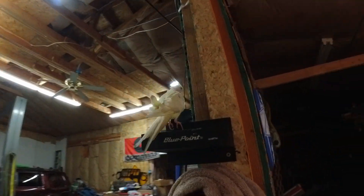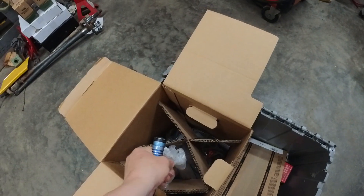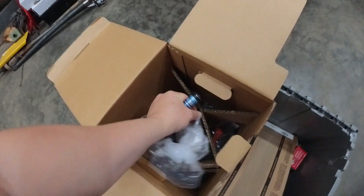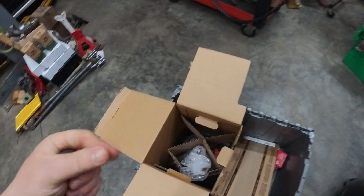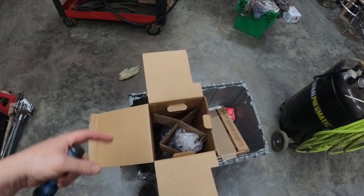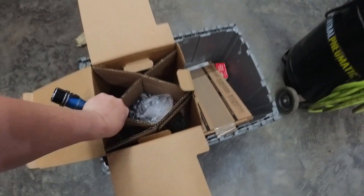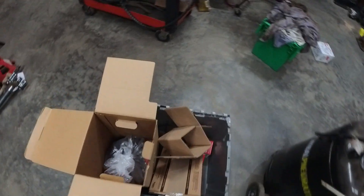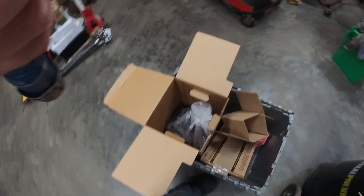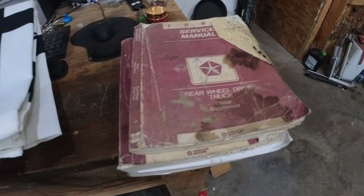There's the shop mascot holding the door down. Here's the new booster — it's wrapped in the box, but you can see this is the rod that attaches to the pedal, and on this new one it's attached like it's supposed to be. We're going to end up replacing the booster because there's no kit or repair for that rod — the clip doesn't exist separately, it comes with the new one. It's 1990, so it's just time to replace some of this old stuff.